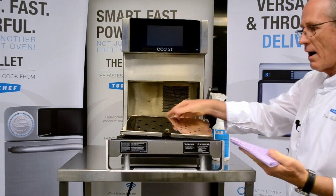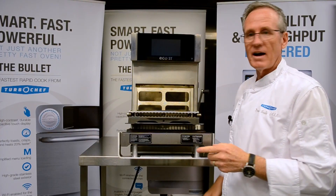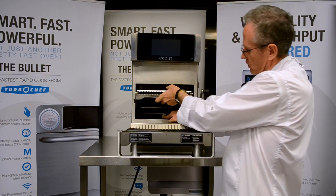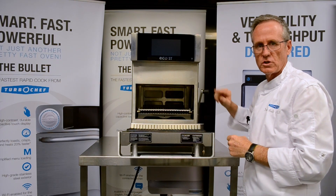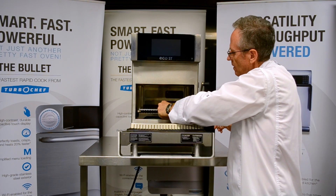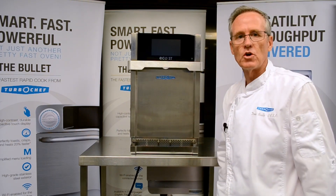Always make sure that you are applying the guard to a cloth. Do not spray chemical directly inside of the oven. Now that we've guarded the oven and put the bottom impingement plate back in, it's time to reinsert the press cassette. Simply lift it in over the top of the lug here, and slide it back into place onto the pin mechanism that opens and closes the press. Once this is back in place, we simply do our screw back up. Now that this is all back in place, we're ready to open our press mechanism again, close the door, and we're ready to turn our oven on.